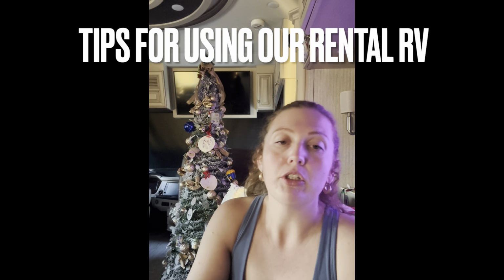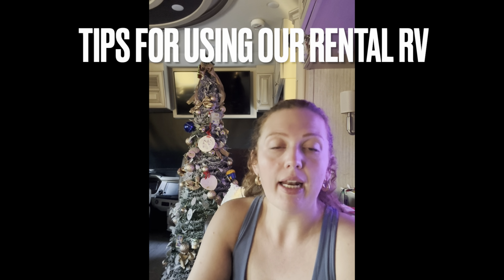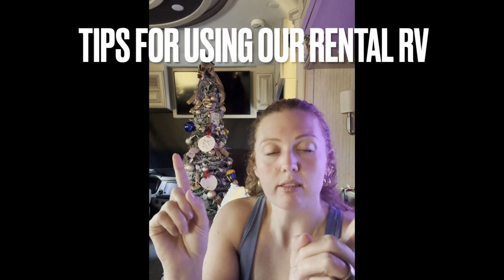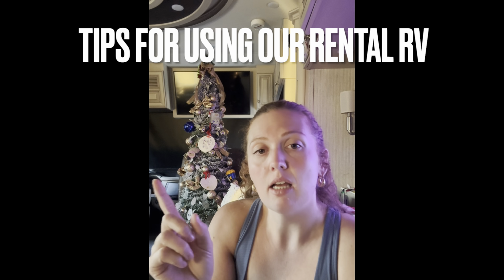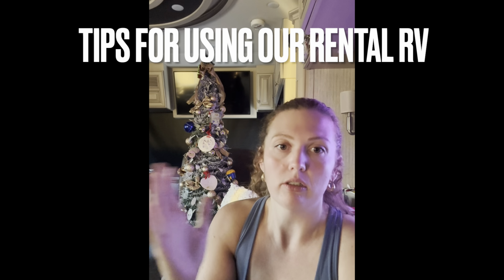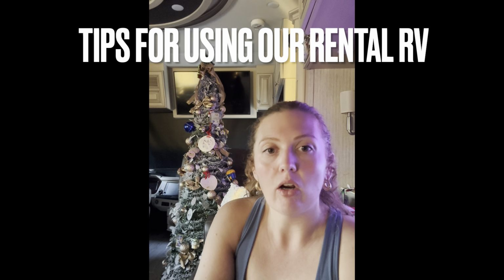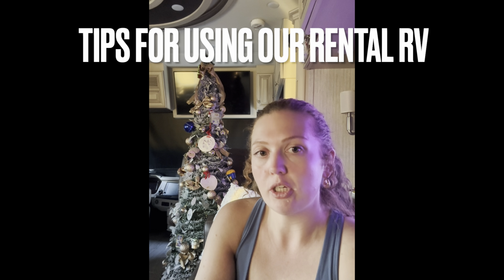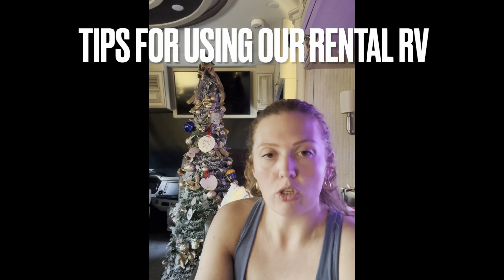Or whenever you're not traveling, you can utilize both and have both the main unit vents closed, and it'll use the duct system. The duct system is all a single system, so if you are running one, you will get air on either side. And there are soft starts, so if you happen to leave them on while you're starting the generator, they will start and not overwhelm or throw a breaker.